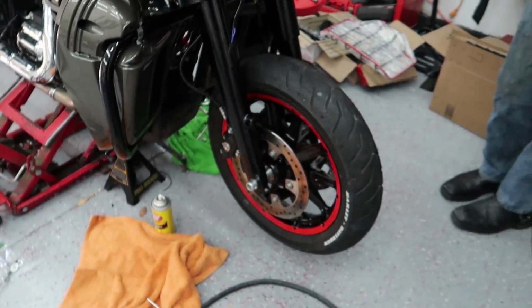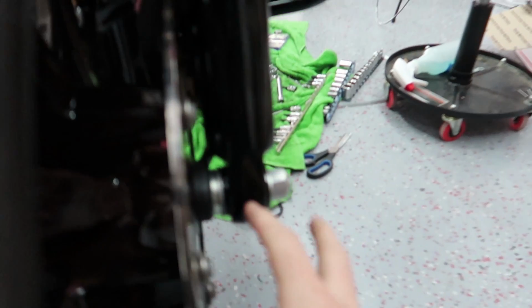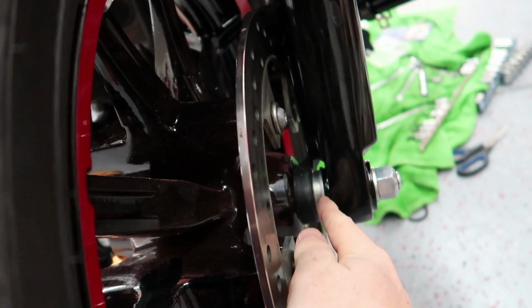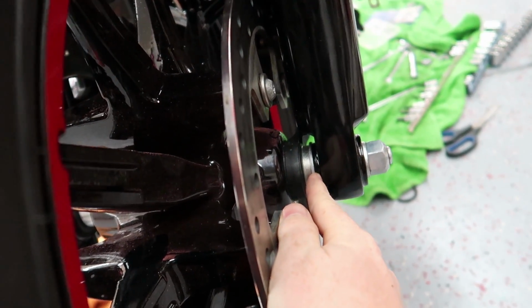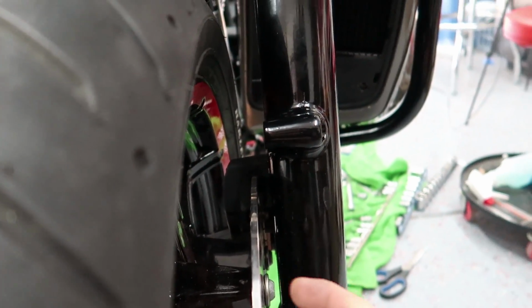So, after probably about 6 hours in total, the front wheel is good. We were able to pinpoint the issue. We ended up having to add a washer on this side. There are no spacers on this side of the ABS. I even went back and checked the footage. There was no spacer here, but that one little spacing was what was causing this tolerance to be off.